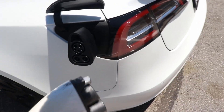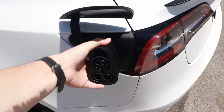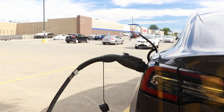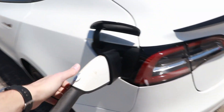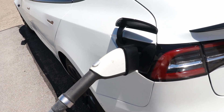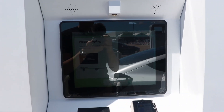Unplugging wasn't difficult — we just had to remember to take the adapter. One nice thing is this adapter actually locks to the vehicle, unlike the AC level 2 adapter which someone could just unplug. This adapter has a pin on top that acts as a locking mechanism: when attached to the CCS port and plugged into the Tesla, the pin covers the latch on the CCS plug and locks it in. The downside is I was able to press the latch enough to stop the charging session, which raises some security concerns if you're away from your car.